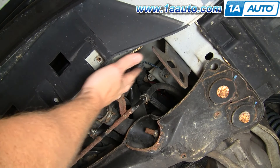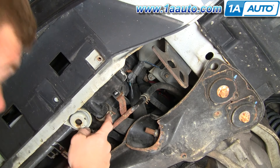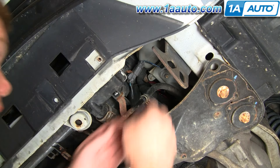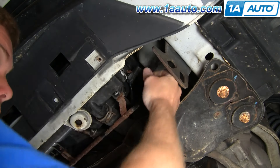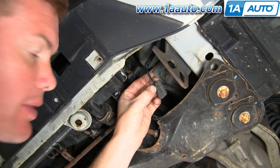While you're up under here — here's the front of the car, this is the radiator, there's the hose — up in here is your connection for your radiator fan. You're going to have to reach up there with both hands and probably block your view, but you basically want to press that button and unhook it. There's the plug, and there's the button you're pressing right there.